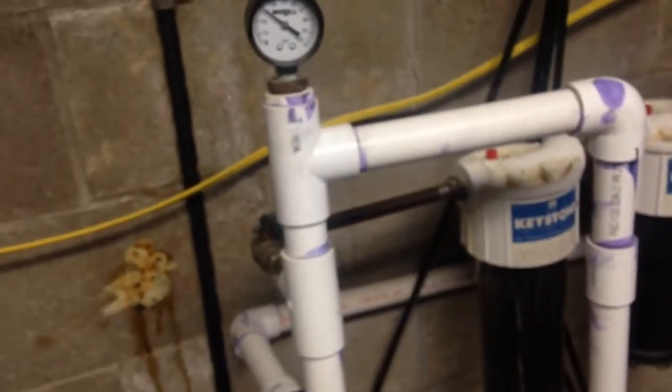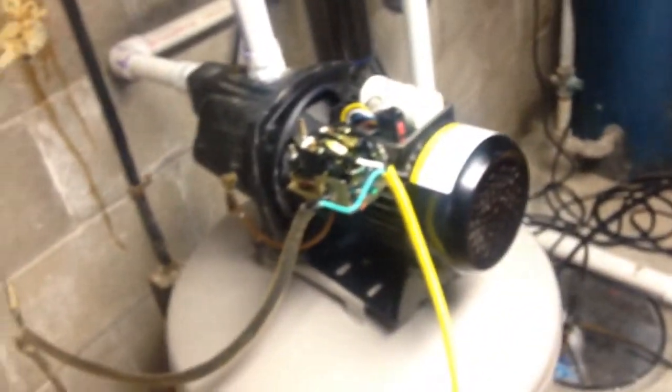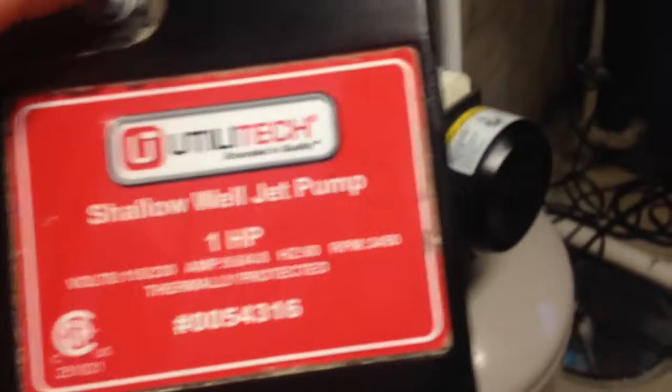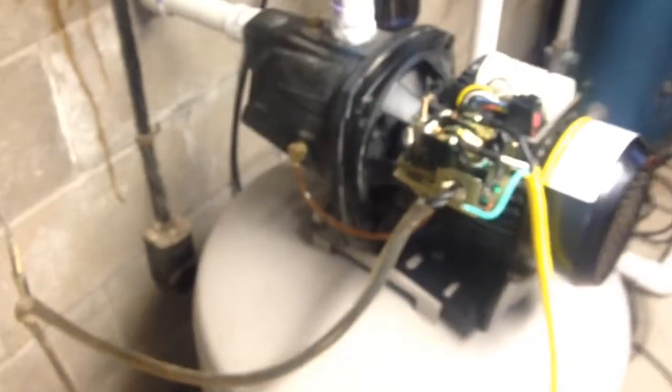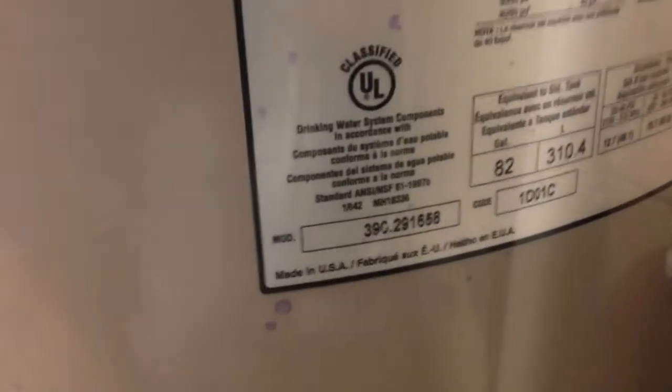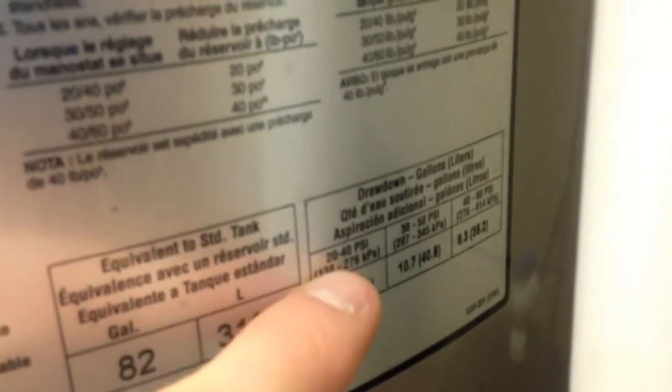It says it can't create pressure higher than 50 PSI, which I personally think is kind of pathetic for a one-horsepower pump — I've seen three-quarter and half-horse pumps that can make higher pressure than that. It spins at 3450 RPM. It's all cast iron, all heavy duty. There's the tank — this pump replaced the old Craftsman pump, which is where that metal bracket came from. The model number is 390.291658. According to the pressure chart, at 25 to 45 PSI it should give me about 11.5 gallons per minute.